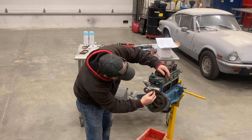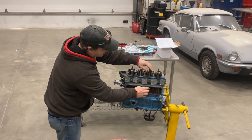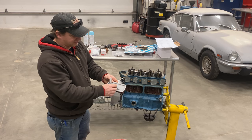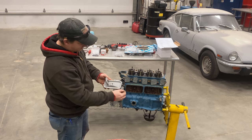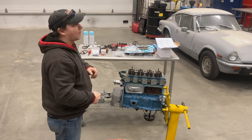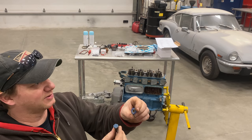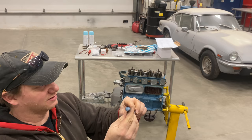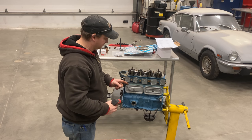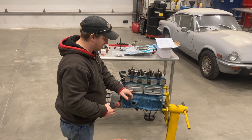Now I can set this little hose up front where I want it and get it clamped down. Now that the head is mounted on, I can put the tappet covers back on. I did straighten up the tappet covers — these have been squashed in a little bit because this is just a bolt and you can over-tighten it. This will squash down and your gasket won't seal very good anymore. The person previously had put all kinds of goop over all these bolts that hold the tappet covers in, so I need to take these over to the wire wheel and clean this stuff off. Now while I'm tightening this up, I'm watching these gaskets — these are the reusable silicone gaskets — and I'm watching to see that they are compressed all the way around, and also making sure that I'm not compressing this too much as well.